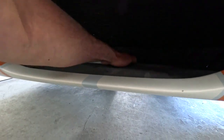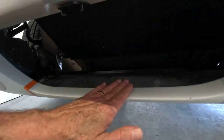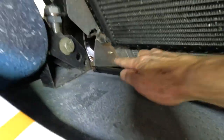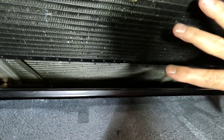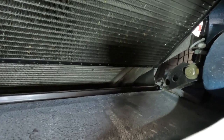What we decided to do — and the SolidWorks model confirmed — is close off this area so that when air comes in, instead of hitting the radiator and getting driven down, there's a panel there that keeps the air going in and then redirects it. You can see the side panels just barely clear the hood. Instead of air being driven under the car, it now builds high pressure up front and gets driven over to the sides, around the top, or the bottom.